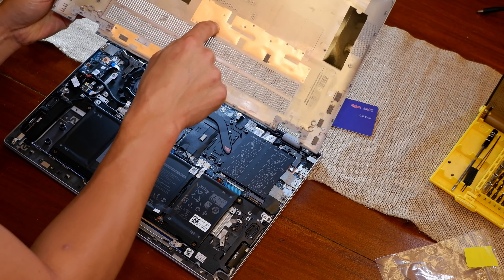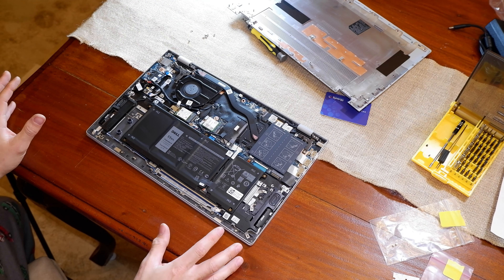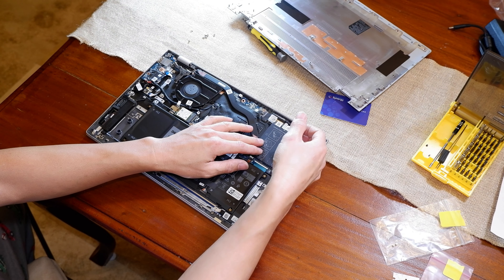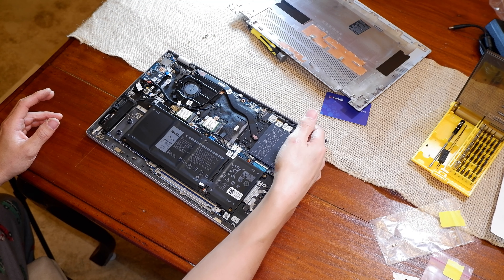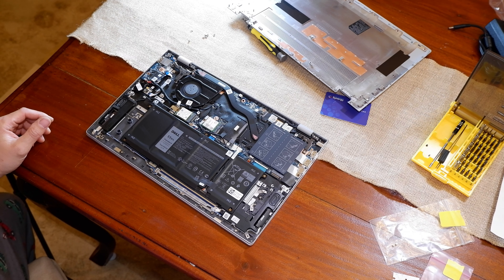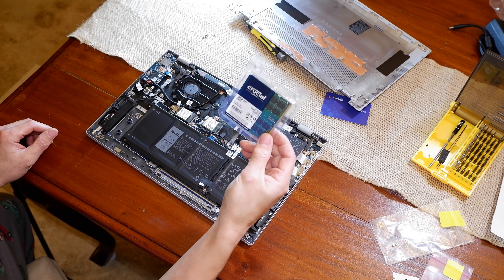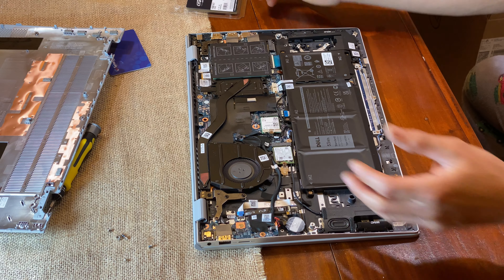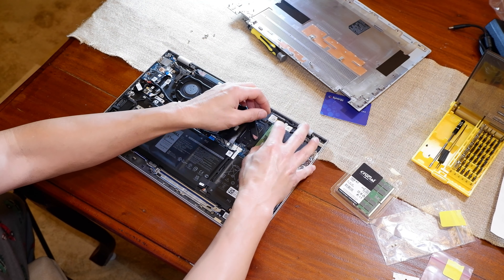There's a little nub and plastic right here. So before we start diving into it, I'm going to show you around the laptop. It looks like these are the two RAM slots here — it comes with one 8GB stick on this side and then a blank slot on this side. I really wanted to just get an additional 3200 8GB one, but there was a Black Friday deal so I ended up just buying a two-pack of 8GB — 16GB total from Crucial.